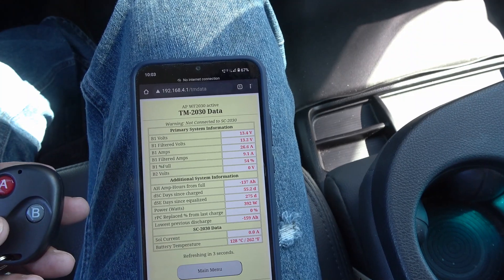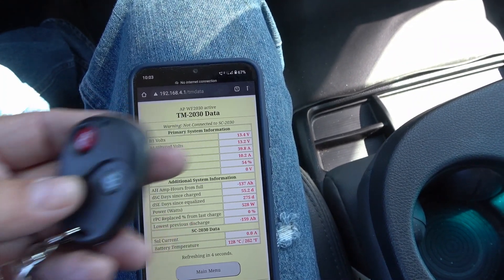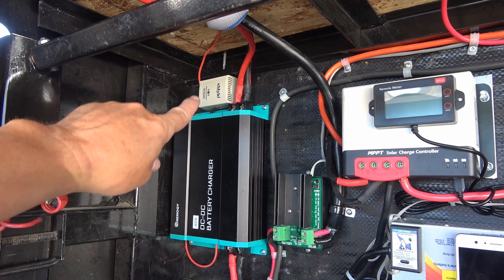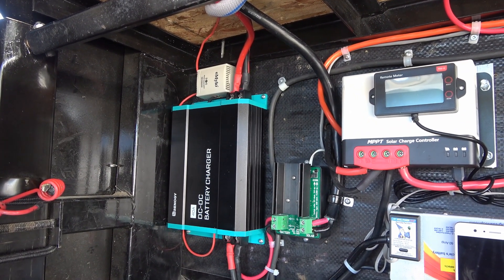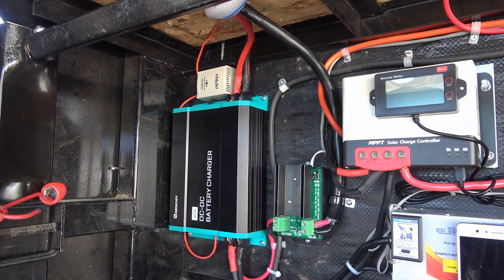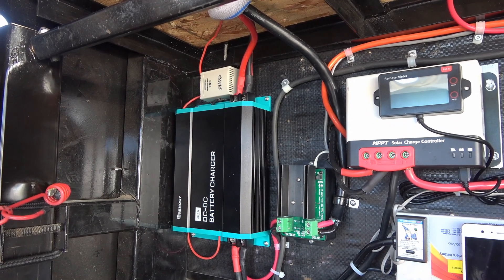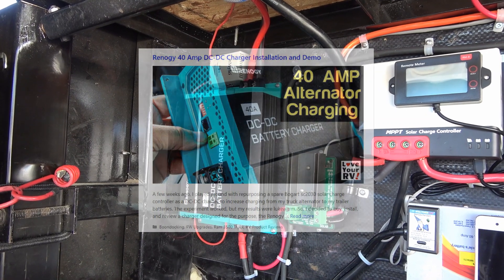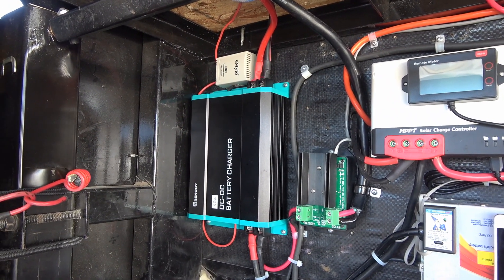Back up again - 40 amps. I was able to just tuck it up in the corner there and wire it in. This little gadget gives me an extra level of control over the DC-to-DC charger. If you want to see my install videos on the charger, I'll put a link in the description below. Till next time, Ray from loveyourv.com - cheers folks!